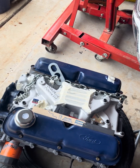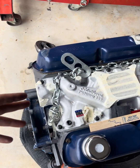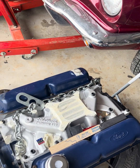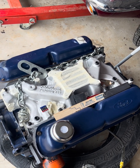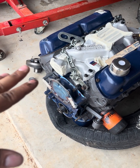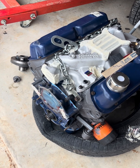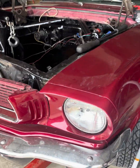That is all you need to simplify a carb swap on a 5.0 fuel-injected motor. After that, you'll need the correct distributor, plug wires, exhaust, and a carburetor — but everything else is the same as putting a regular carb motor in the car. While I have it here, I'm going to find top dead center, remove the valve cover to mark it, put the new timing cover back on, and hopefully have it running within a week.